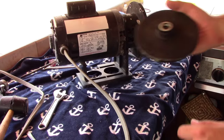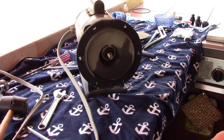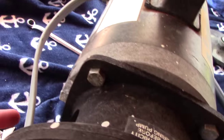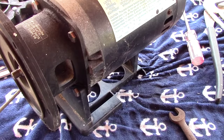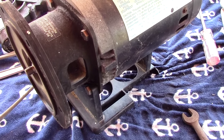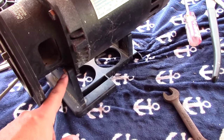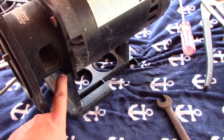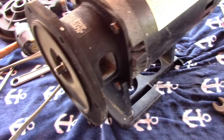Here's the first portion of your seal. Now we're going to have to take off this main bracket. The next thing you want to take off are these four bolts. I don't know the exact size of these bolts, but they're larger than half an inch and smaller than three quarters of an inch. The bottom ones attach the motor to the support platform, so be careful when you remove these because the motor could be a little heavy. Make sure you support the motor correctly when you take these four bolts off.